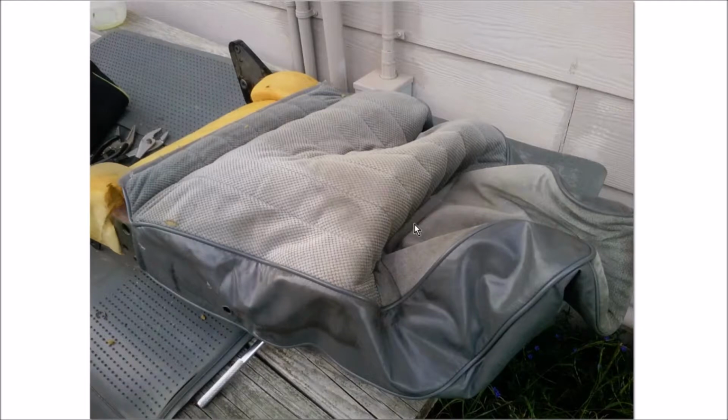Well, I'll tell you. There is a flap. So remember there's this fabric flap here with the metal bar going through it. Well, there's another one, except it's like three or four inches long, and it goes into the other side of the seat through the foam and attaches to the back side of the seat. And that's what sucks the upholstery in, even though it's on a curve.